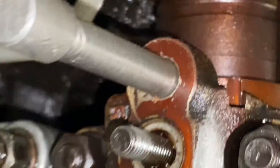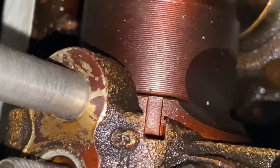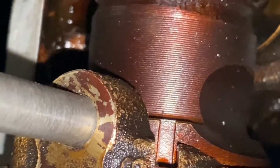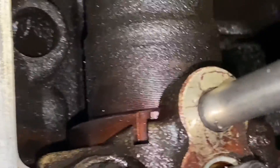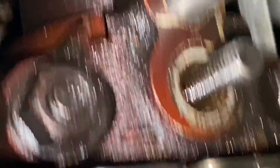Sometimes even four times — all you need to do is check your four timing marks and make sure your camshafts have lined up. What you're aiming for is the slot and the straight sort of groove mark on the camshafts to be in the centre of that slot. Obviously if it's before the slot or after the slot that isn't enough, and then you'll have to loosen everything off again and tweak the camshafts.